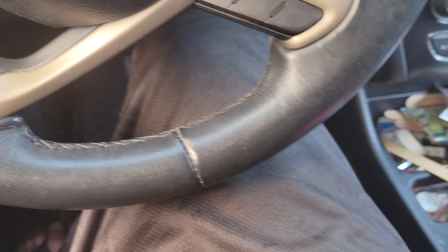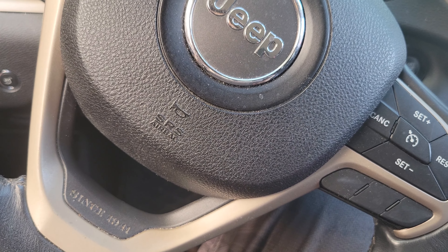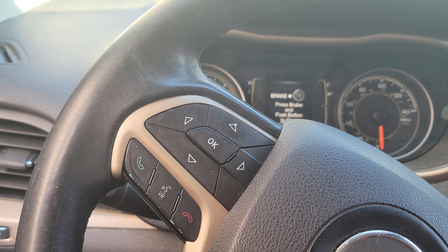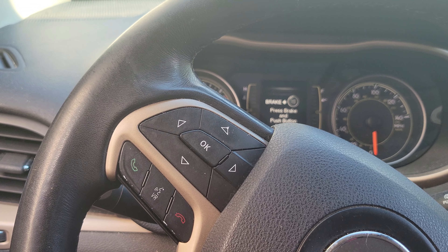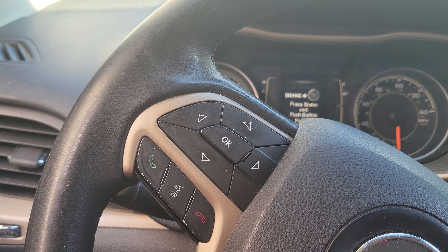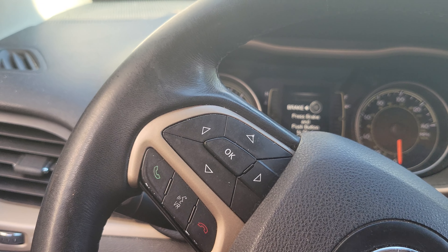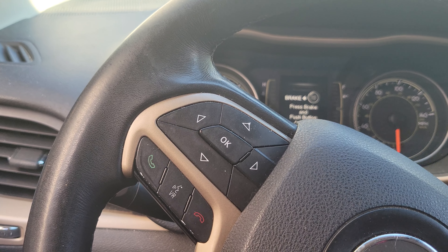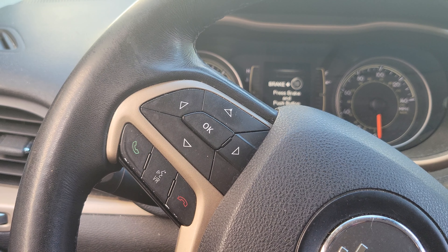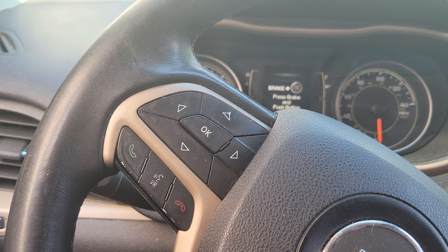Turn that off. Now we're going to put the tire on and torque it down — the torque spec on the lug studs is 96 foot pounds. This is pretty much going to conclude the video. I'm going to take it for a test drive and seat the brakes in. I'll get up to about 10 miles an hour, hit the brakes to a complete stop, and work up to 30 miles an hour to seat them in. I do like to do that for customers just to make sure everything is good. If there are any torque specs or anything you'd like, please comment below and I'll get them to you. If you enjoyed the video please like, subscribe, and hit that notification bell — until next time, y'all have a great day.